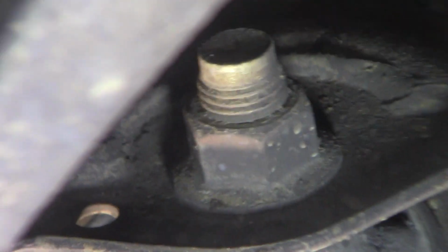It shouldn't be that hard to pull out, I hope. That bolt's easy. That bolt's easy. Yeah, that front one up here, not so much. It's buried under the motor mount. So, I think I'm going to have to block the motor up to get that undone. Pretty sure. That's not looking like a lot of fun to me, but we're going to do it so we can see what's going on with that. I think that control arm's bad after we clean this up. So, let me go clean that up and we'll come back.